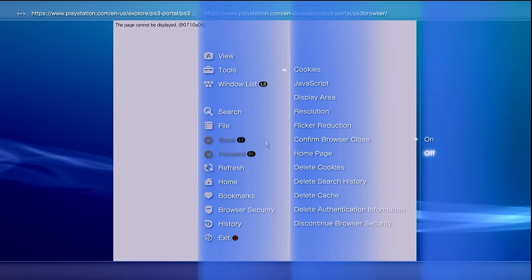Back at the PS3, open up your internet browser, hit select, go down to PS3 toolset, and wait for it to load. As usual, if it asks you to run a plugin, always say yes. Once everything shows up properly, hit OK, come back up to system manager and open up this tab. Now come down to the flash memory patch option, tap X, and tap load patch via HTTP. Tap X and give it a few moments — it's now going to find the specific patch for your system and download it. Once downloaded, it verifies the file is good, and we can tap close.